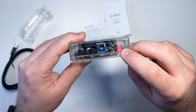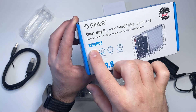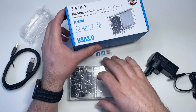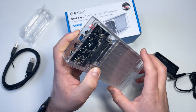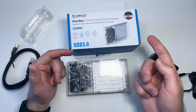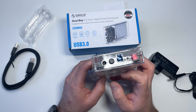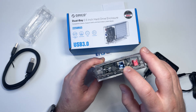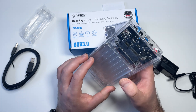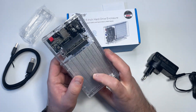This particular model I have is the 2259RU3 — it has RAID support and uses a USB 3.0 Type-B port for connection. You can also choose models without RAID support; in that case you'll get just two drives connected by one cable to your PC and you can use them independently. You can also get an enclosure with a Type-C port instead of Type-B, which includes both a USB-C to USB-C cable and a USB-A to USB-C cable in the package. There are a lot of options depending on your use case, and links are in the description.